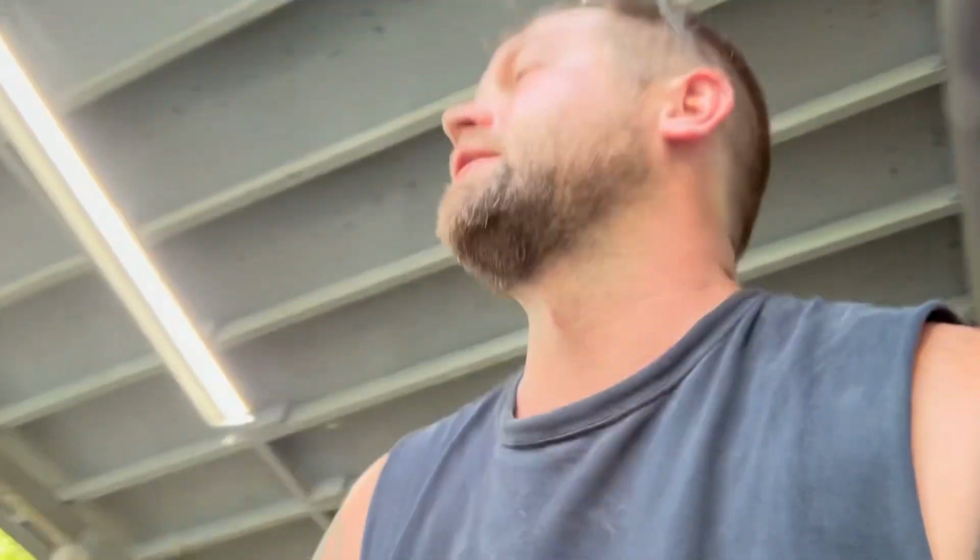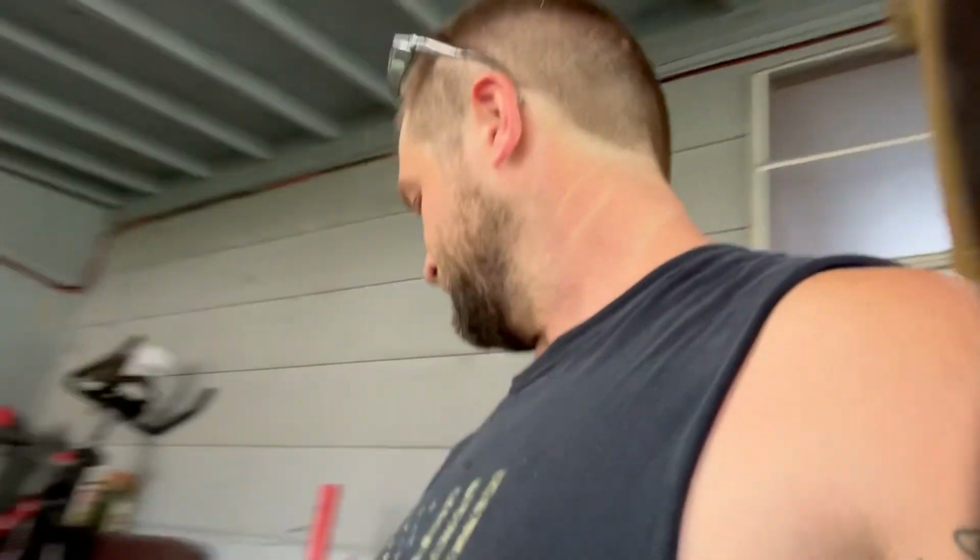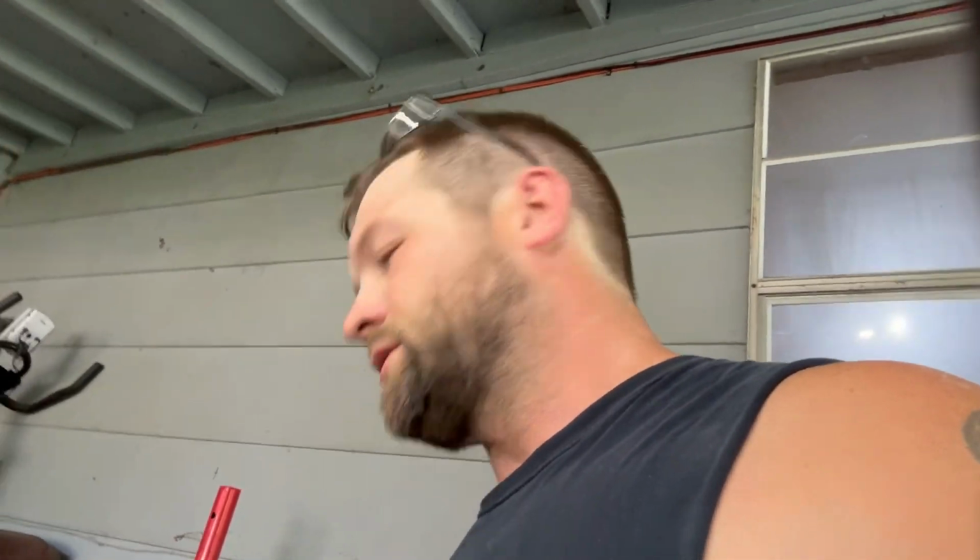And so here we are, moving on to the back. I'm about to jack the body up just a little bit and see if I can get those 2 bolts out of there and bump that thing off of the bracket that it goes to. Might need a rubber mallet for that. She's a tight fit. But yeah, I'm gonna jack up the rear body a little bit, see if I can get that.